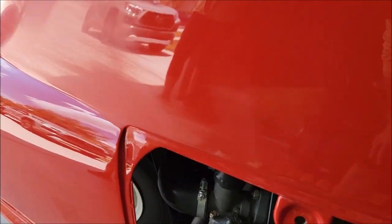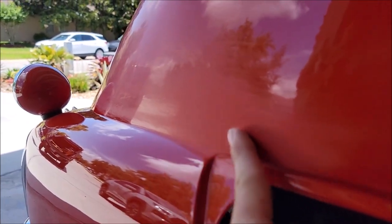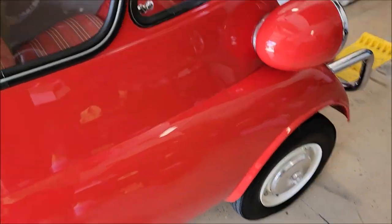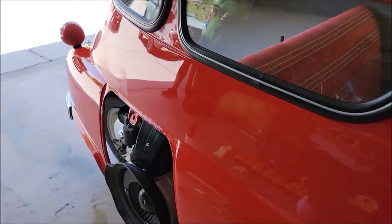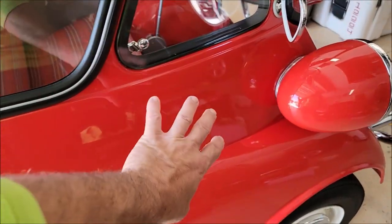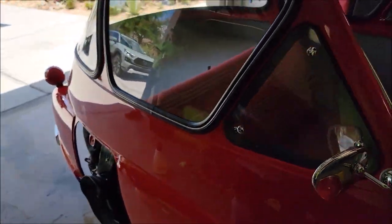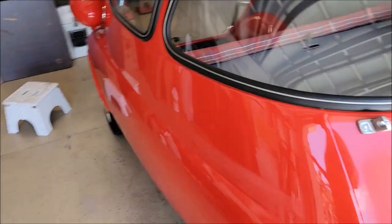This lower section isn't that bad so I'm not real worried about it — the rack's going back on there anyway and it takes your eye off focusing down here. I really wish I could get this section a little bit better. The license plate covers up to here so you really only see that section, but that's what looks bad to me. This had some Bondo work done that was not flat — it is definitely flat now with exception of this dip right here. I think I smoothed this area up enough where when I polish it it will just go away and look a lot better. I'm looking at this in the light and there's a lot of pigtails in here but they look really light.